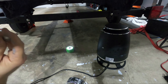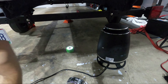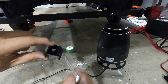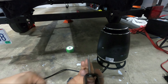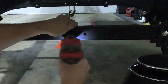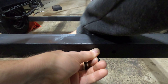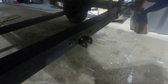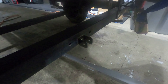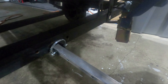The first step to installing the transom saver is installing the bottom bracket that it clips into. The installation is super easy — it's just a single carriage bolt going through the front of your trailer bar, with a washer and lock nut on the reverse side. My hands got covered in 3M 5200 from another part of the install. Once you have the bracket installed onto the trailer, the next step is to attach the actual transom saver. It comes with a pin — you just line it up in place, slide the pin in, put the clip over, and that locks the transom saver onto your trailer.